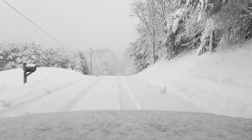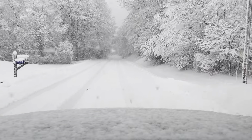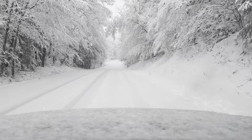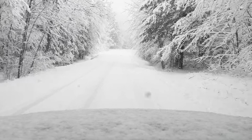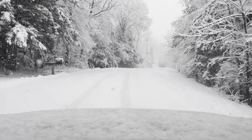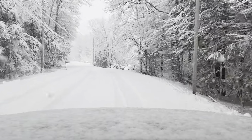Hydroplaning resistance: if it's really puddled up and you're going around a curve, I feel like they lift a little bit. If you look at the tread pattern — and hopefully I'll add a shot of the tread pattern into this video — the blocks are kind of close together, so the sipes between the tread blocks aren't that big. That may contribute to why they're not the best for hydroplaning resistance in my opinion. But really no worse than the summer Bridgestones that came on it; they handle kind of similar, so no complaints there.